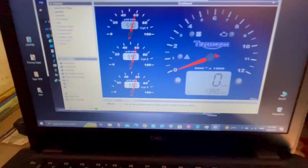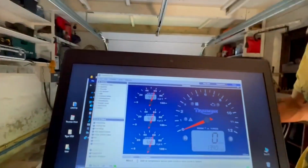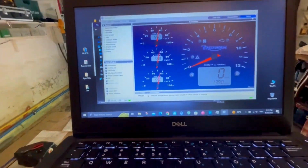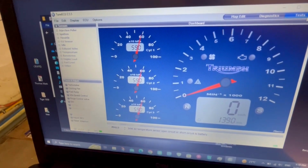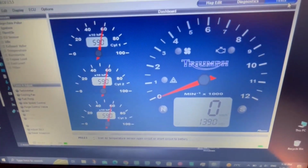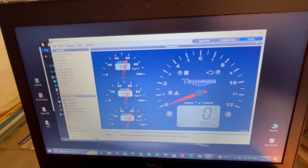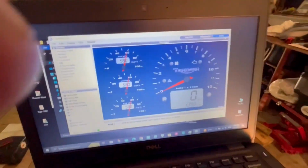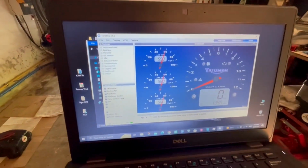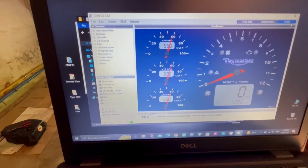All right, as you can see, they're perfectly aligned, and I'm gonna flip the throttle. They should be back in sync. Voila. So that's what you want to see. The RPM is beautiful, 1390. This is a very good rev. I never had this with the original stator and voltage regulator. It's really stable. So that promises well for the throttle feel when I'm gonna ride. It's a little bit lower as well because the temperature is now higher.